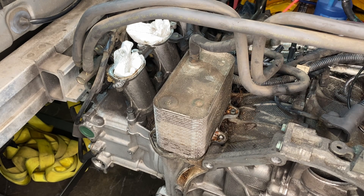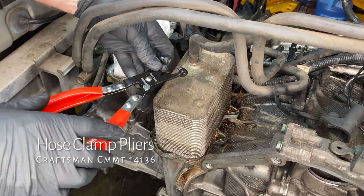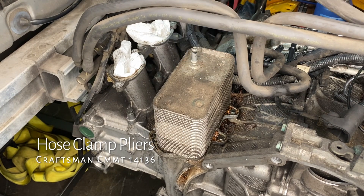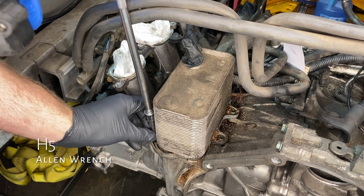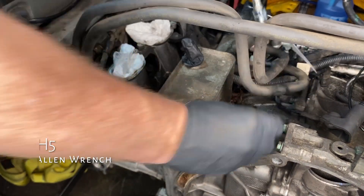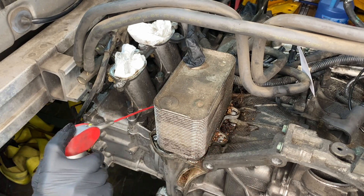The oil cooler is in the back on the passenger side. A little bit of WD-40 to try to break through the undergrowth surrounding the bolts. Disconnecting the hose clamp on the top with that Craftsman tool, then going around it with an H5 Allen wrench. And then to finally get it loose, some more WD-40 and some slapping about.